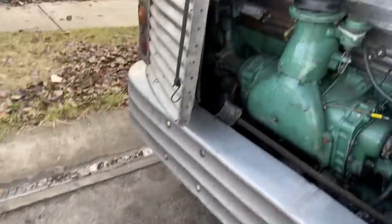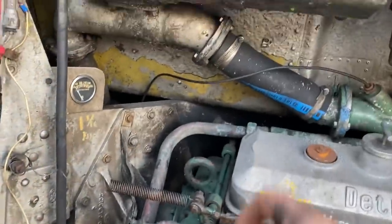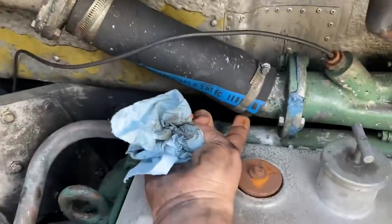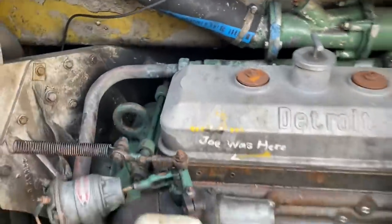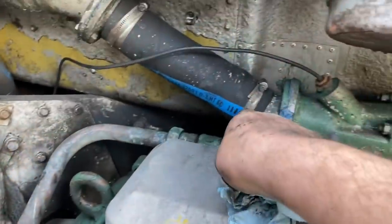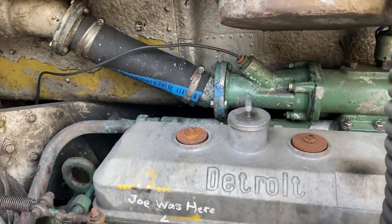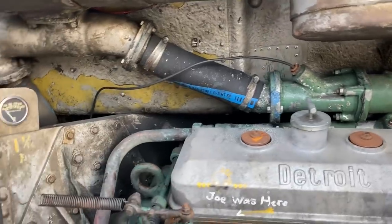I saw a couple drips of coolant on the ground, and I was about a gallon low on coolant, which, with these severe temperature swings, I just have regular hose clamps on here. Like, see right, yeah, that one needs to be tightened up. Actually, probably needs a new clamp. It needs a constant torque clamp on. That's really what it needs. When they get really tweaked sideways like that, they're pretty tight and ready to strip out. But let's see what I got.